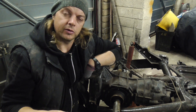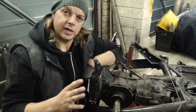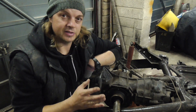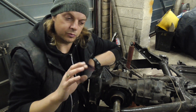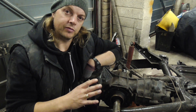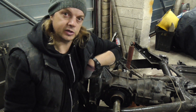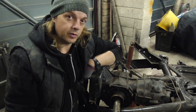One of the things I've seen lots of confusion about online over the last few years is gearbox codes. What I want to do today is show you where your gearbox code should be located on your gearbox, and if it's missing — rubbed out or corroded to the point where you can't read it anymore — a relatively straightforward way of counting the teeth on the ring gear to determine what ratio and which gearbox you've actually got.